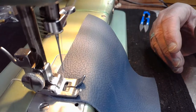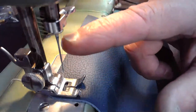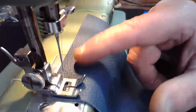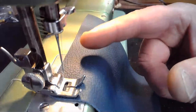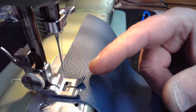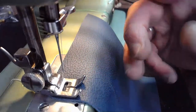Time passes very quick. But what we're going to sew now is using a size 90/14 needle, which is a universal needle. We're sewing leather with a universal needle. And again, if you don't know a thing about needles, needles are designed for different material types based on their point, based on their scarf, their shaft, their long groove, their short groove, and everything else.